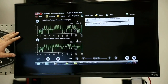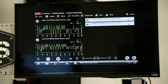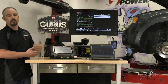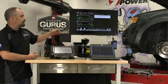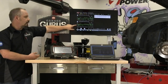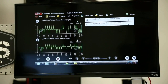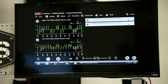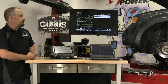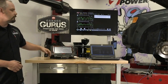You can also drop these down and get a graph view of each sensor. The good news is we do have a miles-per-hour readout for both the left front and the right front. I pulled all the wheel speed sensors up so I'd have at least one good one to compare against. Since I'm getting a reading, I know the wiring is mostly good — I've got bias voltage going and a signal coming back, because the MPH value on the scan tool is an interpreted value. The pulses from the sensor go to the ABS control unit, which does the math and translates that into the miles per hour we see. At this point we don't have enough information to make a call on what this thing needs, so we're going to jump in with some different tools.